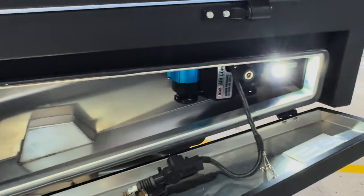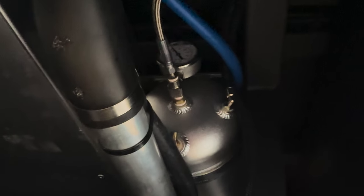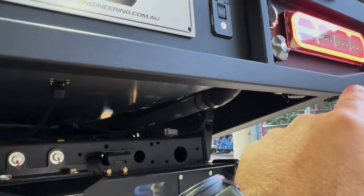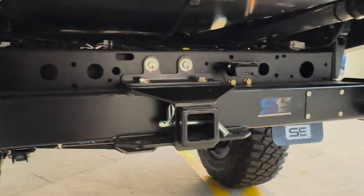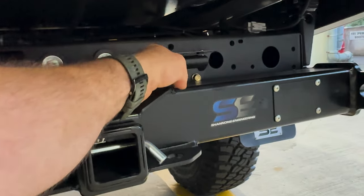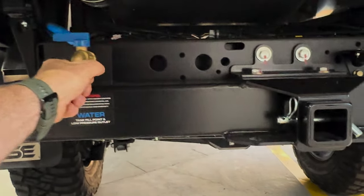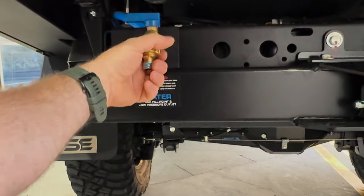Around this side — another toolbox and we've got the notch out for the exhaust, central locking. We have a twin piston ARB compressor there, switched on from inside the toolbox. Underneath we've got two aluminium air tanks connected to the compressor. That gauge there is just a visual gauge. We've also got brass drain valves. There is an ARB quick connect fitting in each toolbox for pumping up your tyres. We've got the Marks four-wheel drive high mount tow bar — a three and a half ton tow bar with five ton recovery points on the ends, with the plug mounted up nice and high. That low pressure tap outlet is handy for washing hands, feet, or filling a glass of water without needing to use the pump. That's also how you fill the tank.